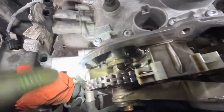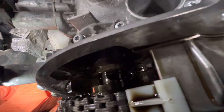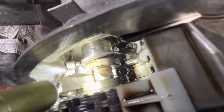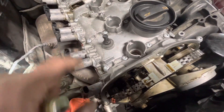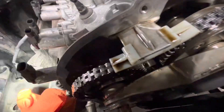This is the solenoid, and that little peg right there is pushed out when it's energized. It goes into this ramp, and the ramp pushes the sleeve that has the lobes one direction or the other — one is responsible for moving it forward, the other for moving it backward. It has to be actuated at just the right time because it has to be at the heel of the camshaft.